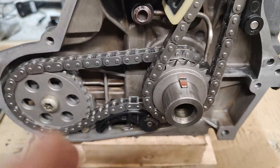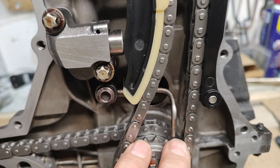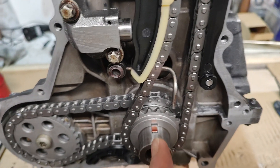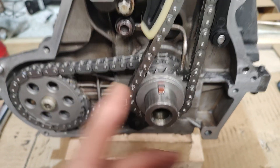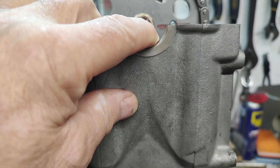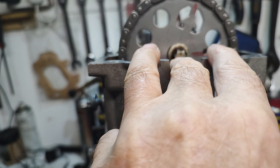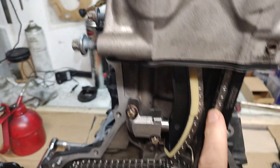Right, you'll see now what you're aiming for. You put your chain on — you can do it all with the head on. You'll just line your sprocket up. You'll know it's at top dead center when that's there, your piston's at top dead center. You'll also see that the half moon is directly in line with the cylinder head, so you now know everything is at top dead center. The valves are rocking and it's just at the slack — right at the very slack.